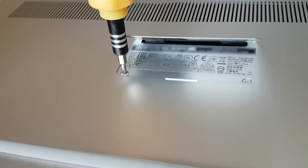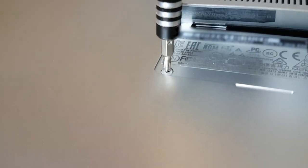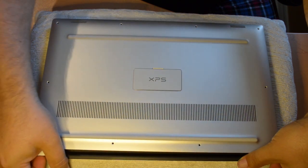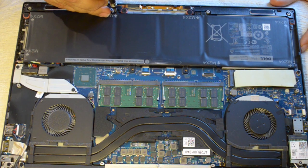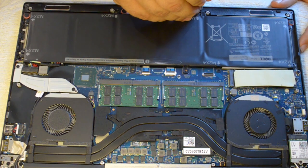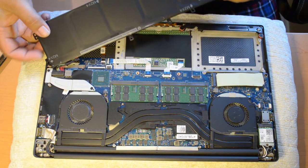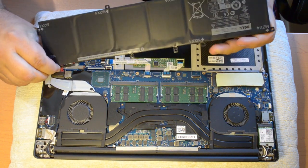Don't ask me why this panel is necessary — it's just the way Dell does the XPS. The first time I pried off the bottom panel it was a little more resistant, but this gets easier each time you do it. Next, make sure you detach the connector for the battery. In my case, I actually removed the entire battery just to be sure. The last thing you want to do is fry your motherboard because it still had power running through it.